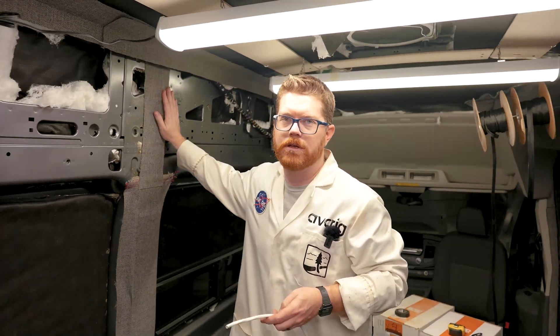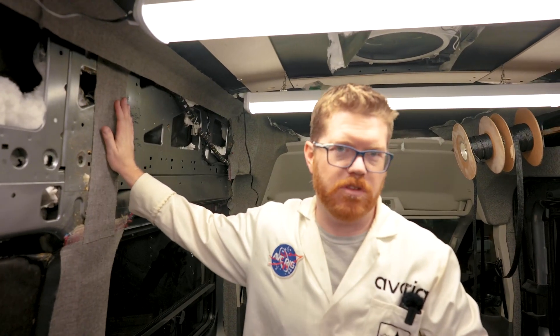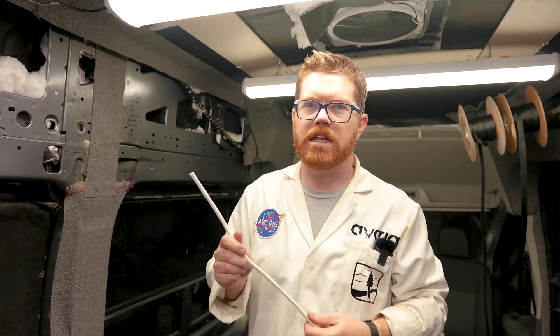As I'm pulling this wire, it reminds me it's really smart to run an auxiliary leg to each destination in the van. So if I'm pulling wire up to my control panel, I always run an auxiliary or two. For just that purpose, we started stocking a 14-4, which means it's four wires inside at 14 gauge. I use this as my auxiliary runs to different locations in the van. In the future, if I need to add a new appliance or forgot something, it's there — it's some cheap insurance, and it's a good idea to include in your build.